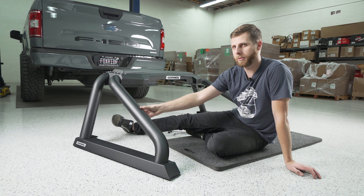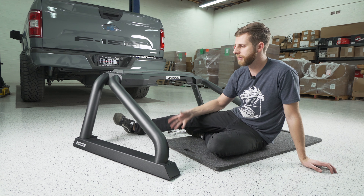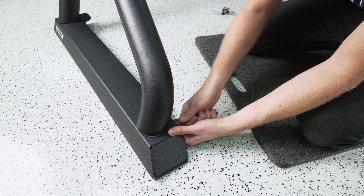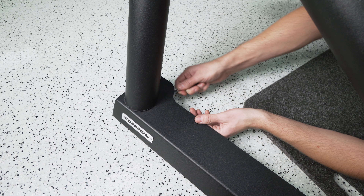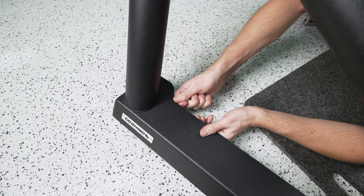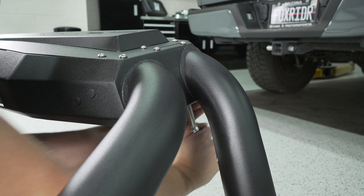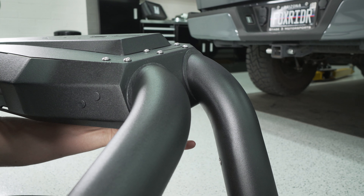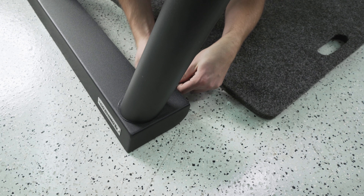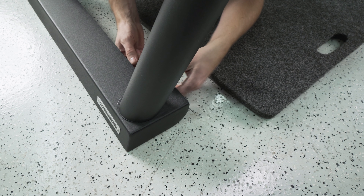Now you can see we've got the bar pretty well together. At this point, if you're going to install the optional mesh plates on the side, this would be the time to do it. There's going to be just a couple Allen head screws with washers that are going to go into the threaded inserts on the bars. After you have that done, go through and tighten all those 14 millimeter bolts to really lock this thing into shape. If you are actually mounting this to a truck, I definitely recommend that you set it on the vehicle first and kind of test fit with that — make sure you like the way it's sitting before you tighten everything, because the fitment can be really kind of hokey on these.